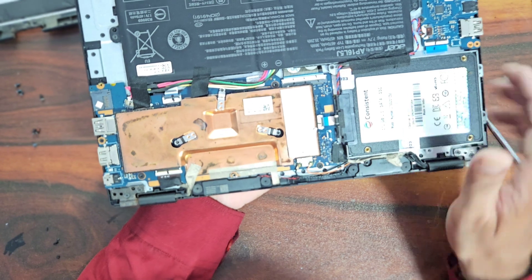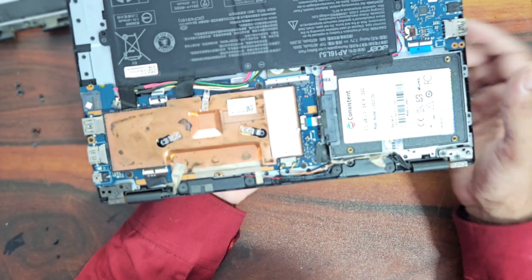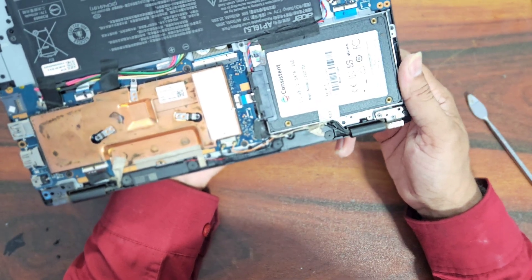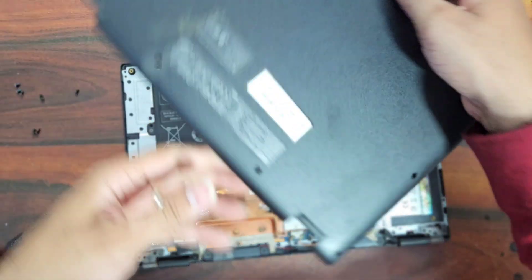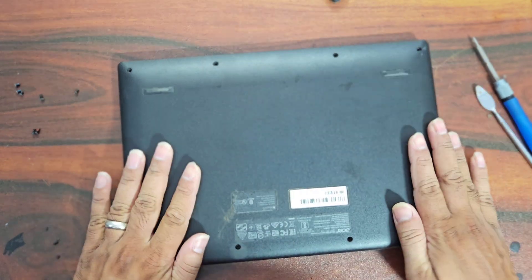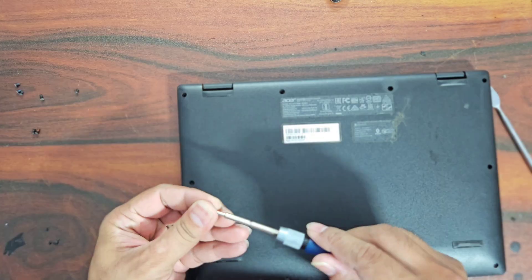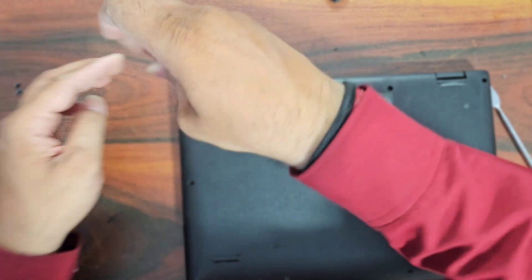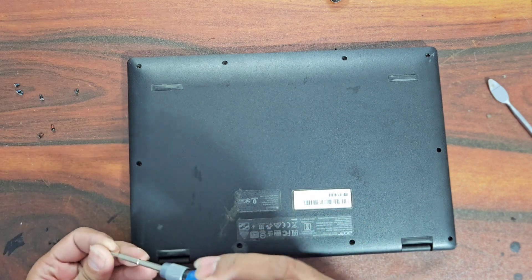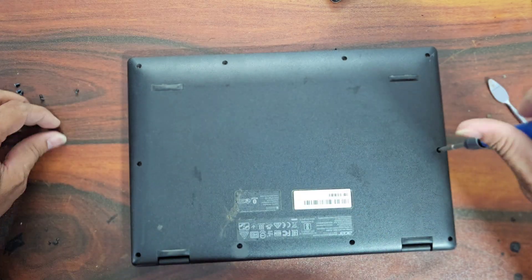As mentioned, there is not much that can be done for this laptop — the processor is limited, the memory is stuck on the board, there is no extra slot for memory and no extra slot for an SSD. So we had to replace the existing hard drive. Now we have to close the enclosure of this laptop and put the existing screws back without adding any extras.